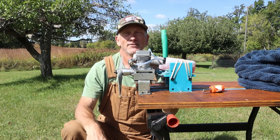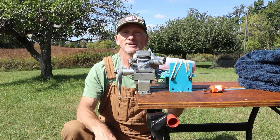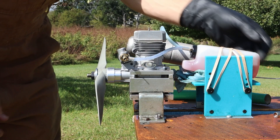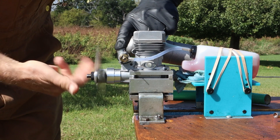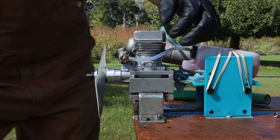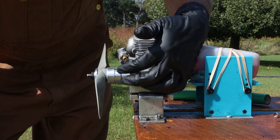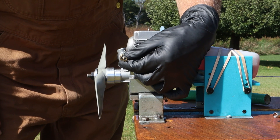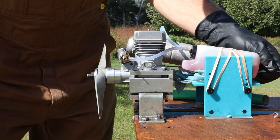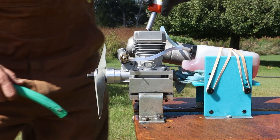It's just a spectacular day and I'm excited to get it to run. I'm going to attempt very shortly to see if I can get it to hand start just for the heck of it. If not, I've got my starter here and we'll put a run on this engine. I've got a glove on this hand because the high speed needle valve is just a straight little beam coming out here — it's not angled at all. So it's a lot easier for me to grip and feel this from behind without getting too close to the prop to make any minute adjustments. I believe I've got the high speed needle open about two and a half turns from fully closed.